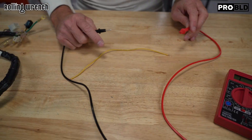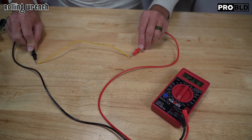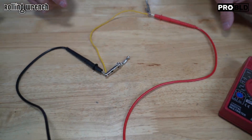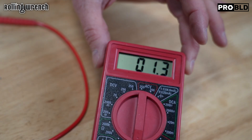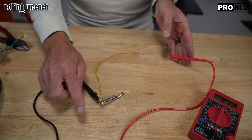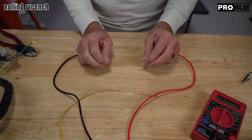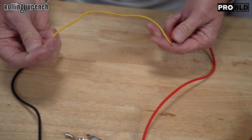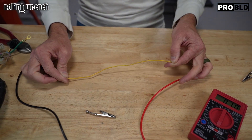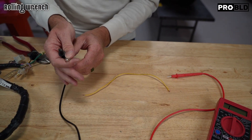Say I wanted to check these two wires, or this one wire on both ends — this is how you're actually supposed to test it. I'm going to touch one there and one there, so we're touching each end of the wire. We have a resistance reading — that's perfect. You want to make damn sure, if you had an expensive high-end multimeter and you were holding these wires in place, you can't do that because it's going to measure the resistance of me. So if I'm holding the wire like this, you can't do that. There's resistance, but say if it was cut down the middle, there would still be a resistance reading because it's measuring me like I'm a wire. In this scenario you can't do that because it's a low-grade meter.